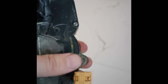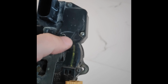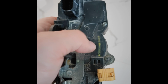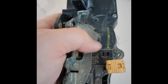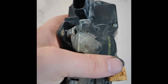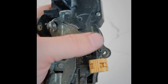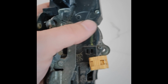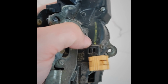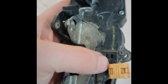So now this piece that goes here was not hanging freely, and it's really difficult to explain it even when it's assembled in front of you in the car. But this piece actually goes in front of this piece so that this will dangle with no tension whatsoever on it. When they reassembled this at the wrap shop, this piece was behind this piece, which put tension here on this part. And that's what caused that tab to break for the locking cylinder outside of the car.